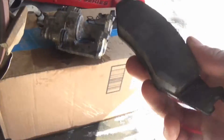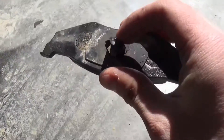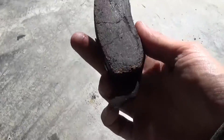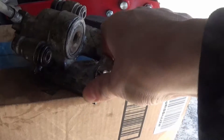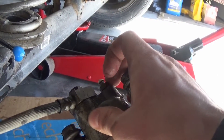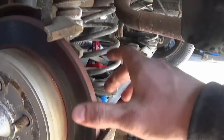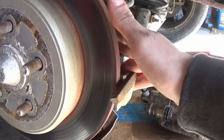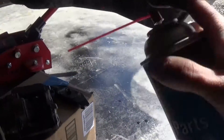I may have to replace the pads. I don't know if the cracking on them is normal, but this pad got bent in the process. The pads don't look too happy. I've got to get new caliper mounting bolts and add brake fluid. Turns out the bleeder valve was actually loose - I don't know why, but I tightened it down and now there's no more fluid coming out. After this, I'm going to go around and check the torque on all the bolts and clean things up with brake parts cleaner.